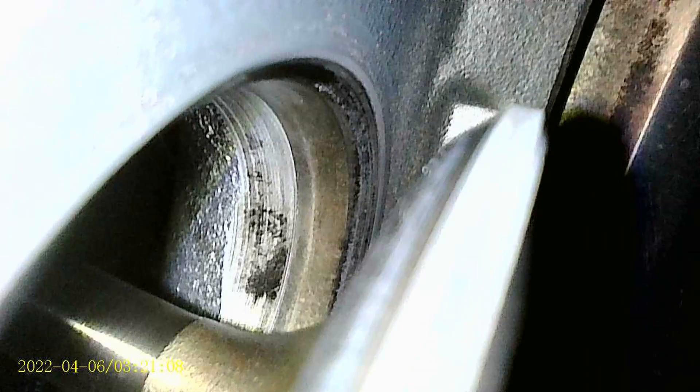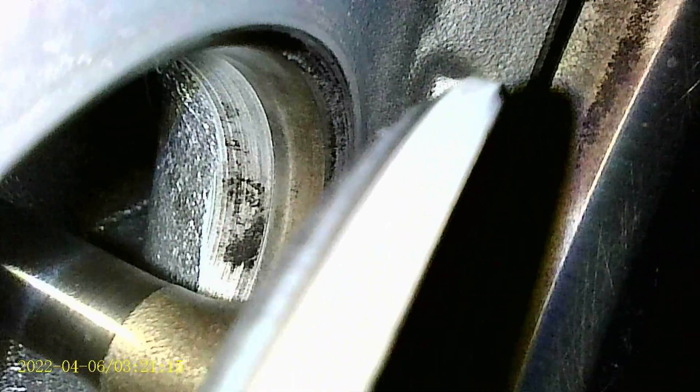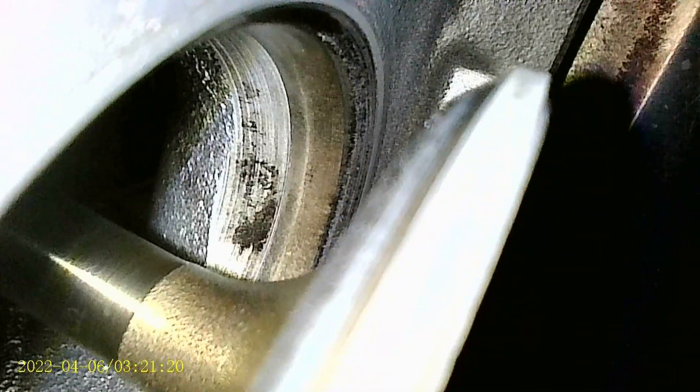Yeah, that's a lot drier. That looks a lot better, that looks more normal — it's not just completely drenched. We're going to go with a different camera angle. And now we can see a lot better. So there is the valve — you can clearly see. It's got a little soot on there. It's the intake valve. So already, that's a little weird — it's got a lot of soot on it.